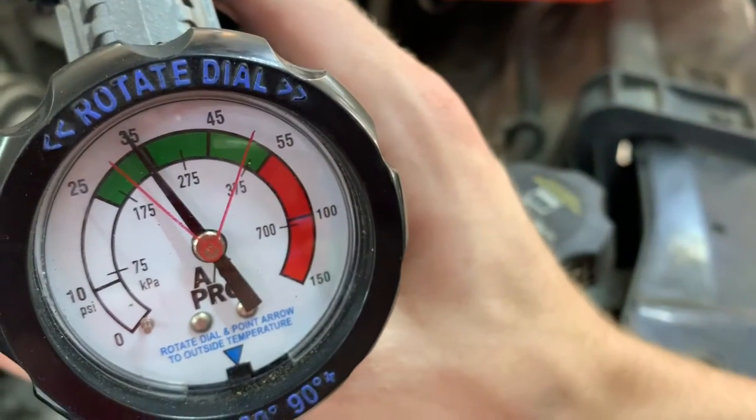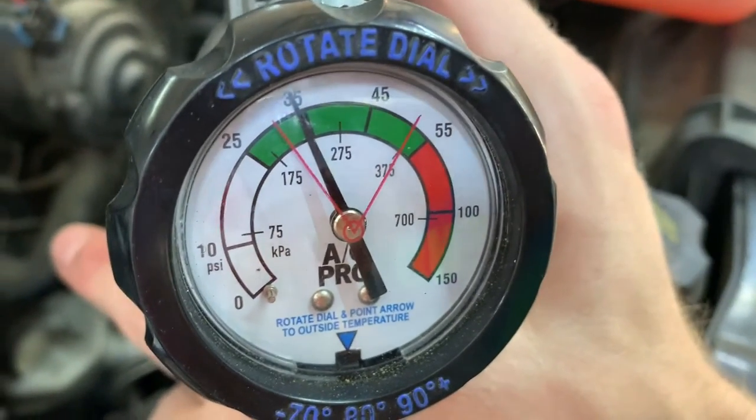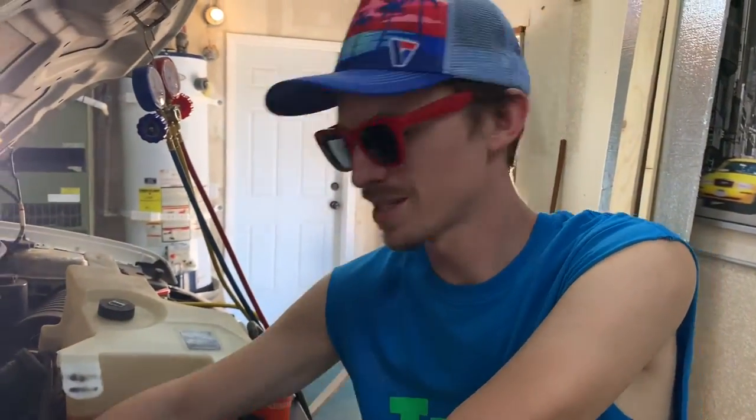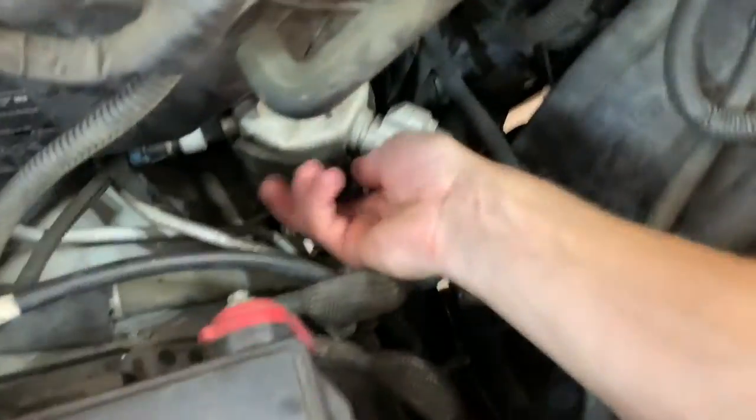We're sitting just a hair below 35 PSI on the low side — that's just one 12-ounce can of freon. I'm pretty happy with that. You don't want to overfill the compressor; if you overfill it, it's going to run for a second then shut off repeatedly. So I'm pretty happy at 35 PSI. It's disconnected — put the cap on, make sure your O-ring is still down in there. This one still looks good. Screws right onto the accumulator. I'd say we are good.